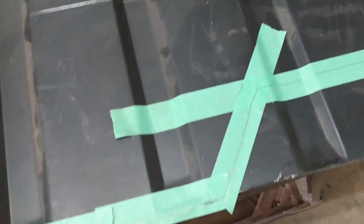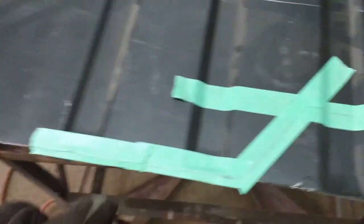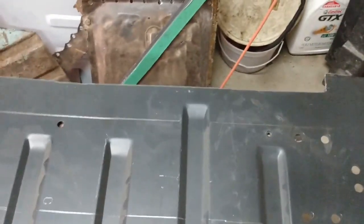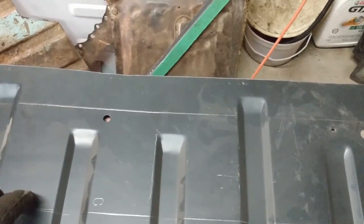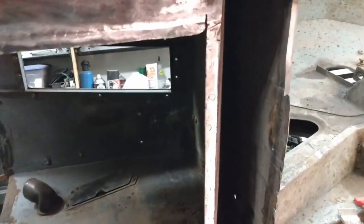I've now marked out where I have to cut the pan to line up — that'll end up being a butt weld. So what I'll do is I'll make sure I am well inside that line so I don't cut off too much. I've also marked out the width of the main floor reinforcing section. What I'm going to do is actually drill holes in the floor here, along here, and then do my plug welds from this side, from the bottom, along those two ribs. On those ribs I won't punch any holes, but in these two down here, and this one across here, and this one here, those will have the appropriate holes in them.